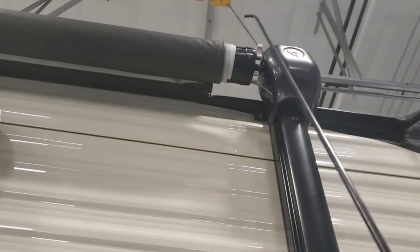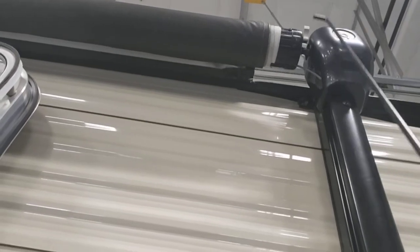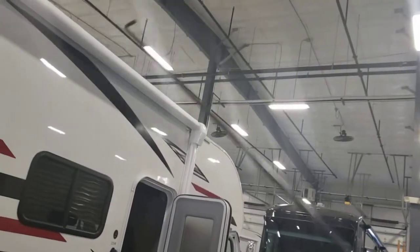Moving along. Other part of that storage, you got your crank handle and your awning handle. So for your awning, very simple to use. Undo these latches. There's one of these on each arm. You come up there, use your awning stick. You flip this, you pull this little gray thing down. There's even a little chart there, up and down. Pull it down, you come over here. You hook it up to here. You pull the awning out. It'll come out to about here-ish. That's hard to do one-handed, so I can't show you in the video because I'm doing it one-handed. But it's very easy to use.